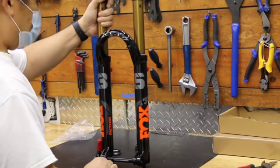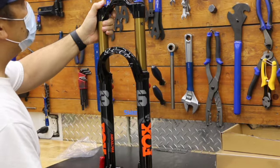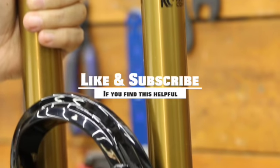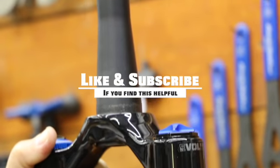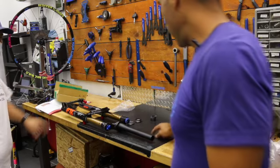The owner chose to go with the new 2021 Fox 36 — very sexy glossy black paint, 15mm through axle, nice bright signature orange, with the Kashima finish on these stanchions. The steer tube comes extra long so you can fit it to your bike. We'll probably be making a cut once we find our measurement, and we're going to be installing the crown race on this one.